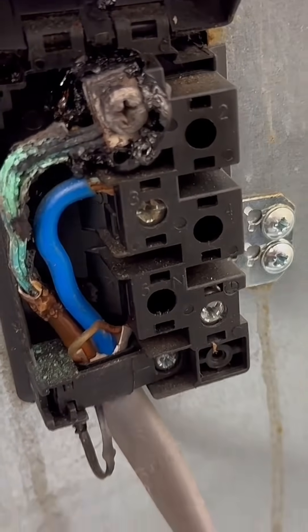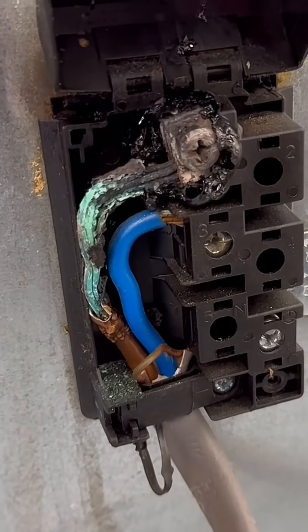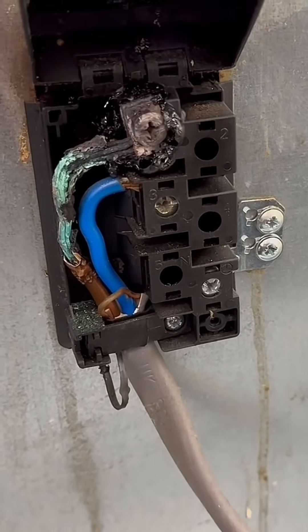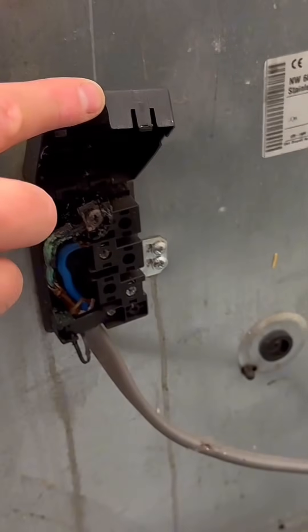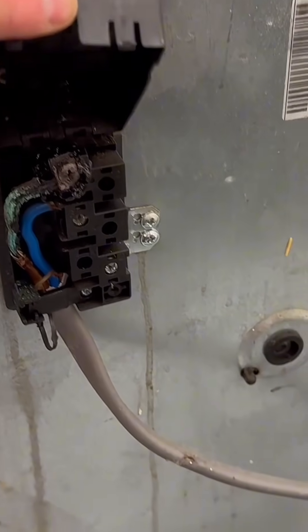When we opened it up where the connections are, you can see that the line conductor is burnt — which is quite unusual, because sometimes you'd probably suspect it's the neutral, wouldn't you. It's always the neutral when something's burnt out. So what's actually happened is the line conductor has been affected, and it's important to say this isn't because the oven has got too hot. We don't need to install a fan behind here — it's not a heat transfer back from the element on the other side.